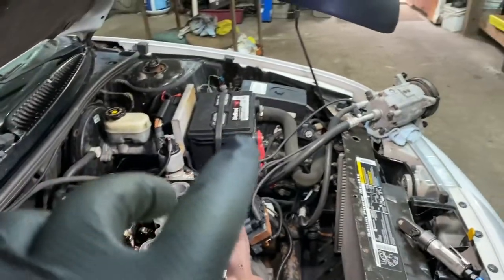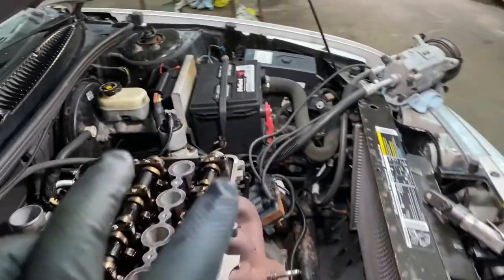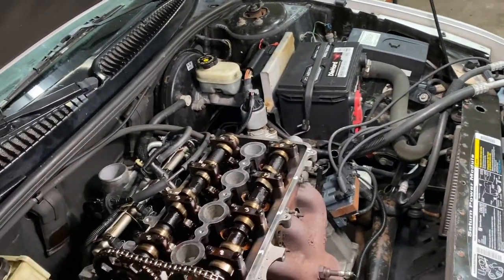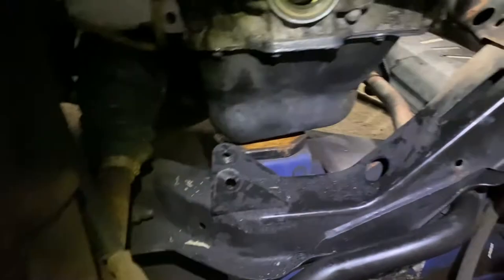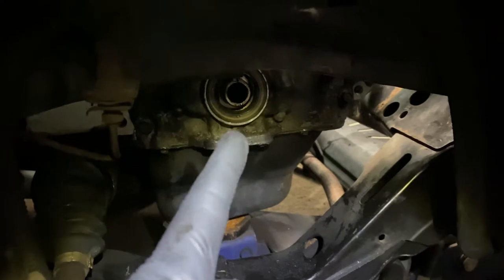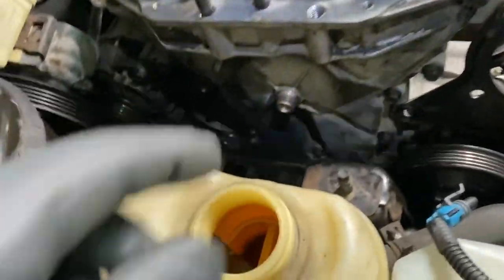And you put it in, you hang it on the top, then you go on the bottom and you align on the bottom. You have to align the oil pump with the crank so you can slide the rest of the timing cover on. Let me show you over here. We can see it. Alright, see over there? Now, before you can put it all the way on, you have to align. There's a flat spot on the oil pump on both sides, and when the crank is at top dead center, it's going to be flat left to right, so you just slide it on that way, and then you can tighten down all the bolts. Don't forget the ones in the middle.